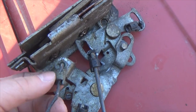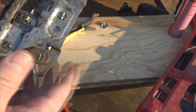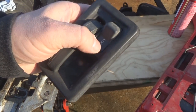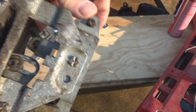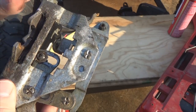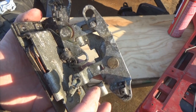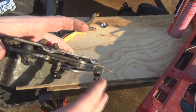Those of you following the videos about rebuilding these half doors - you may remember me mentioning the locking mechanism issue. That rod connects here and goes all the way to the inside door handle. Whenever I'd push up to try to lock the door, the rod would simply bend but it wouldn't actually push that over to lock the door. It would unlock fine but it wouldn't lock. When I got it apart, I was looking at what the problem was. Mechanically, I see nothing wrong with it - it's a perfectly good solid latch. But see all the grime buildup right here? Over the years, junk builds up inside all this grease and it turns into something sticky, gooey, really thick. It probably was grease at one time, but it gets so thick and gummy that nothing moves correctly.